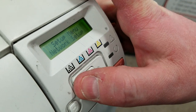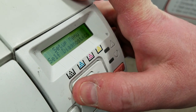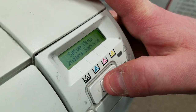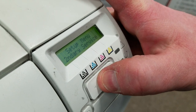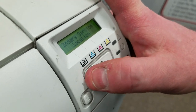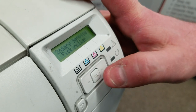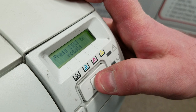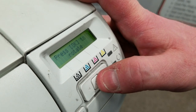Hold until it says 'Secondary Service Menu.' Hit OK to go into the secondary service menu, then hit the left arrow button one time so it says 'Pick Roller.' Hit OK — it's going to say 'Press OK to rotate.' Hit the OK button and you'll hear the printer spin the rollers.